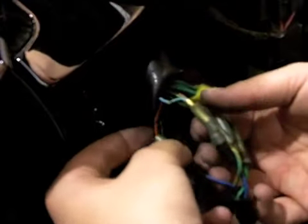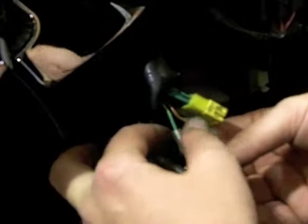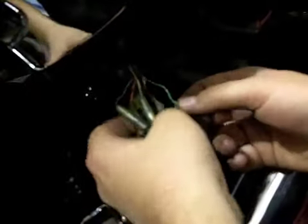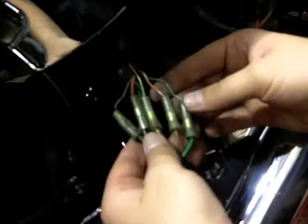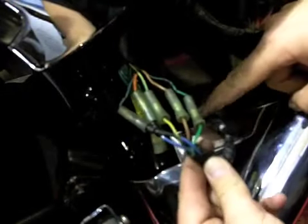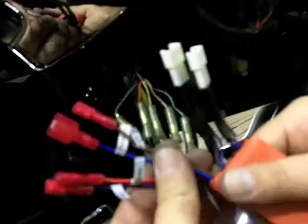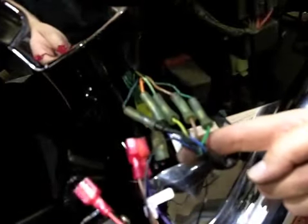I just got done testing all of these wires. The orange wire is my left turn, the blue wire is my right turn, and the brown is my tail light. What I'm going to do now — this is the input side, the wires connected to the stock harness going toward the battery, and then this section on the end is my output, which goes directly to my tail light and turn signals. I'm going to cut each of these wires and fix one of these spades to the end so they coordinate with the run turn brake controller, taking the input for the right turn, left turn, and brake.